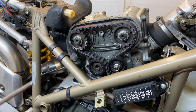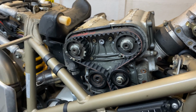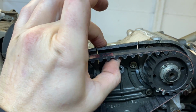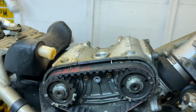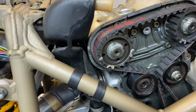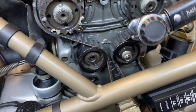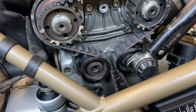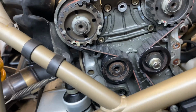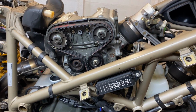So finally, vertical cylinder, as I mentioned, 5mm Allen key should go straight in there, which it does. You're looking with moderate tension just to see it at the top of the cover there, which is spot on. And again, because you haven't got the official belt tensioner, this is as good as it's going to get. I'm happy with it all. I've set the tension, I've already torque wrenched it using my crow's foot because the space in there, as you can see, isn't great. And again, just for peace of mind, I'll do a full rotation and just check everything's lined up and that I'm happy with the tension on the belts.